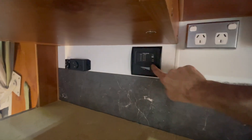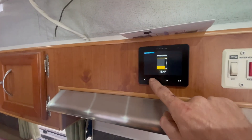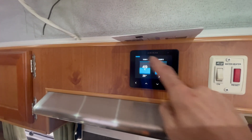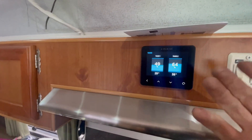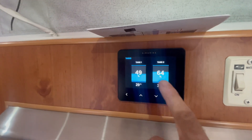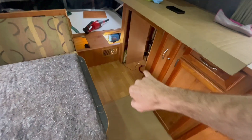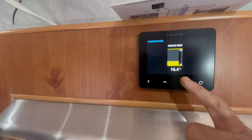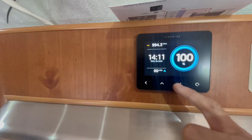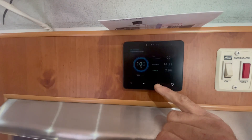These differential pressure sensors are very accurate - they're voltage sensors, not like your old resistive arm-style senders. It's a voltage output, very linear, and you can set calibration points. We've done a full drain and a full fill-up and then put a midpoint accuracy on that. For the fridge temp, there's a little temperature sensor down there - our mate is yet to put the fridge in, so it's ready for him to monitor his fridge temperature.